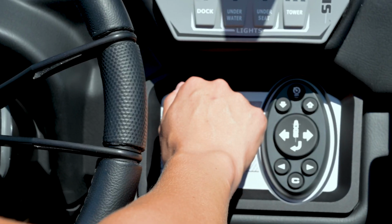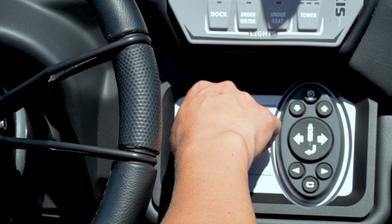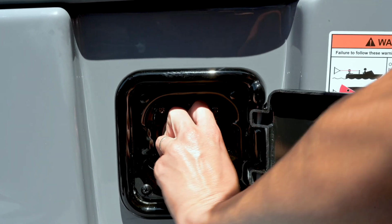If you turn the key and the dash powers up, your blower turns on, you've definitely got power to the boat, but when you turn the key to start the engine, it either clicks or just doesn't quite have enough power to turn it over. Check your voltage gauge. If it's under 12 volts, there just might not be enough juice there to start the boat. If you have a dual battery switch, I would switch it over to battery 1, try starting it there, and if that doesn't work, switch it over to battery 2, try to start it there. One of them might have just enough juice to get you started, and then you want to make sure you leave the boat running for a while so the alternator will actually charge that battery back up while the engine is running. If neither one of those batteries is enough to start the boat, you're probably going to be waving somebody down and having them tow you back to the dock.